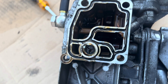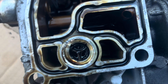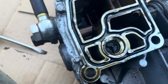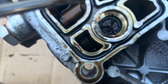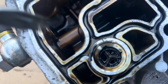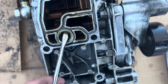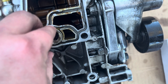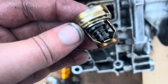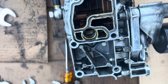One part of this job that I have not been able to find any videos on is how to get this check valve out of here. Mine's kind of messed up. Basically what you're going to want to do is put a flathead inside of here. I'm just going to pry up on one side, pry up on the other side until eventually it comes loose. Pry this out one by one and you'll see it start coming out slow, and then eventually you can just pull it out by hand. And there you have it — there's your old beat up warped check valve with plastic on the inside.